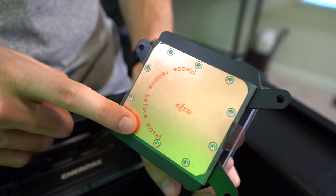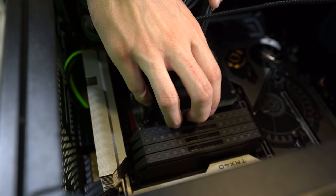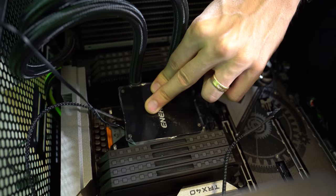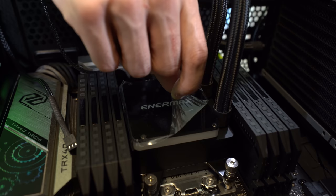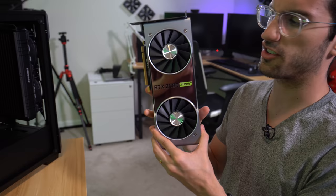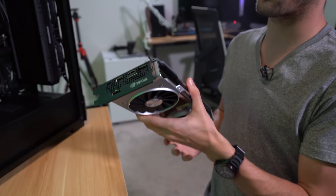Please remove the protective cover before install - if you do not remove it, you will have a bad time. Solid copper block going down. This is going to fit snug. We've got the spring-loaded screws - drop these down and torque them on. That is clean. This is the reference Founders Edition RTX 2080 Super. It has neon green accents and unfortunately NVIDIA hasn't updated it so you can't change the color of the GeForce logo, so we have to stick with neon green. That's why our cables from nsource.net are also neon green. We're also installing the new Elgato 4K60 Pro capture card right under the card.